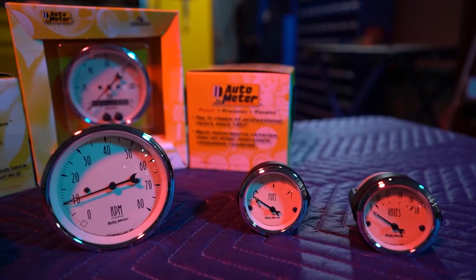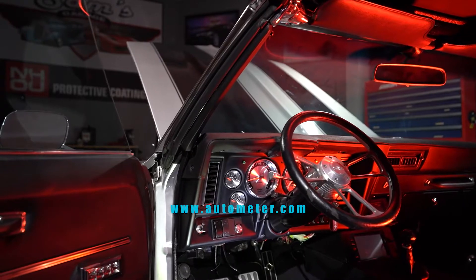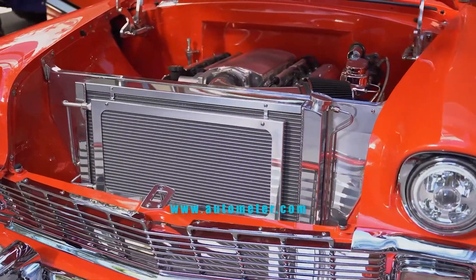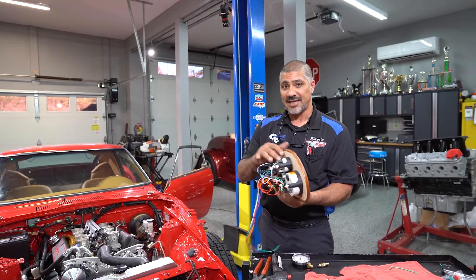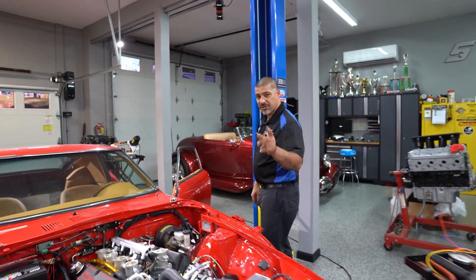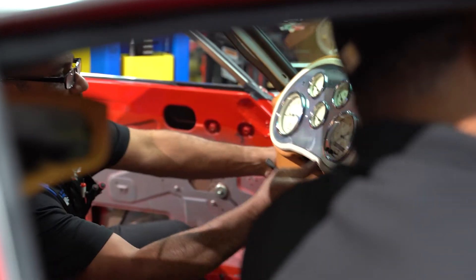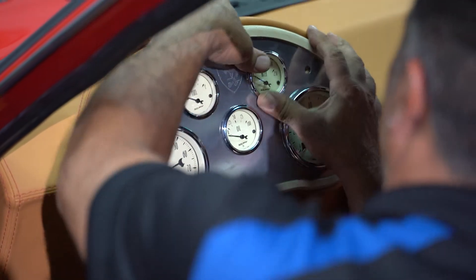That looks so good right there, and it's going to work just as good. Autometer — not only do they have these nice vintage gauges, they've got air-fuel ratio gauges, digital gauges, and gauges for, let's say, a '57 Bel Air where you want to replace the entire instrument cluster. They have a complete instrument cluster kit that goes right in there and utilizes all Autometer gauges with bezels and wiring. They've never let me down in the 22 years I've used them. I'm going to do a little trimming of the fiberglass inside this dashboard to get that entire unit in here, then wire everything up — the cluster, the AC, and all the instruments.